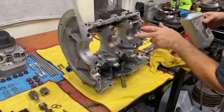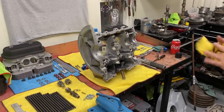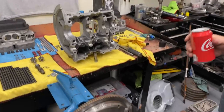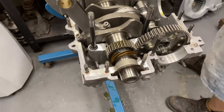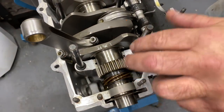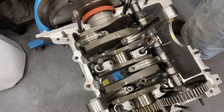I have a split bearing in the front of this — normally there's a circle bearing there. The split bearing is much more robust than the standard circle bearing that usually goes behind the timing gear. On performance motors I usually buy two main bearing sets and put the split bearing in the front — or the rear, which is actually the front of the motor. All right, we're ready to put this together.